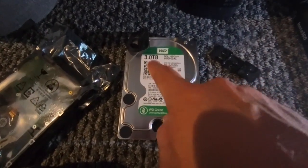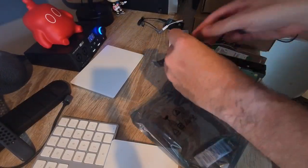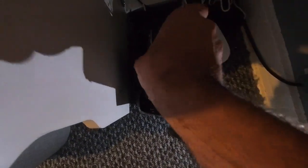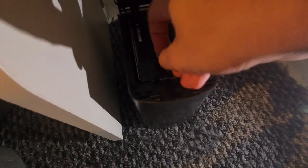We need to undo this to be able to remove our drives. Drive one is this one here, so I'm going to replace this one first. You can see what we had in here before — a WD SATA Green — and we're going to switch it out for the new WD Red Plus. We'll need a cross-headed screwdriver to undo the two screws. We'll put the new drive in — there we go, nice and snug — and pop the caddy back in. We are going to replace the second drive in a couple of days, so we'll close it up for now.